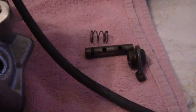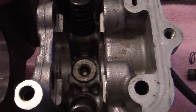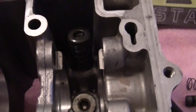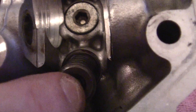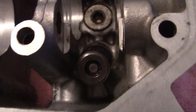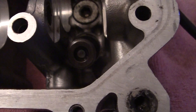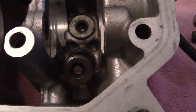We have to remember that the O-ring one goes in the top. Now the next thing we have to do is compress the springs. Once we compress the springs, this is the very top of the valve right here — this little piece right in here. And that's held in there by two little tiny clips, but the only way for the clips to come out is the spring has to be compressed.